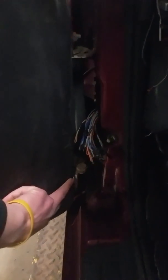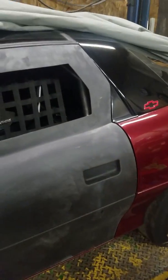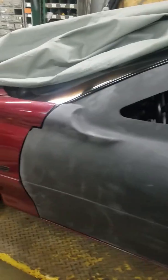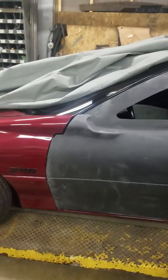Another thing I don't like about this door is if you look, I've got a big shim right here. And I'm gonna make an actual plate that thickness. That's actually just a big washer, but that's the other thing, is this door would not line up without shimming that bottom hinge. Latched. And it's shutting a little tough right now because of that point right there is bottoming out. But you can see it lines up well with that shim, but that was the other problem, is that bottom gap was non-existent without shimming that hinge. So that's not a huge deal.